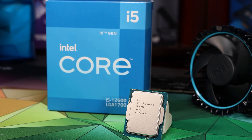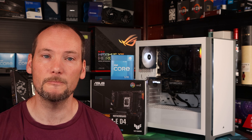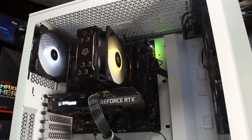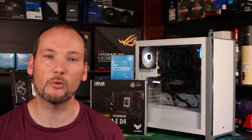Using the stock cooler is a perfectly good way to keep costs down while building your PC, and it will be adequate for the vast majority of users. However, if you're looking to improve CPU performance, run lifted power limits, or handle demanding workloads, you will absolutely benefit from a better aftermarket cooler. A 4-heat-pipe tower cooler with a 120mm fan tends to be around $30, and that's a really good investment — you can run with a much lower noise profile, keep temperatures low, and maintain higher performance for demanding CPU work. In a hotter environment they're certainly a sensible idea, as they allow the CPU to manage temperatures better over long-term use.